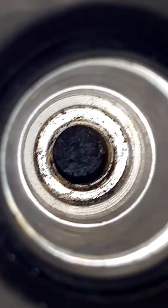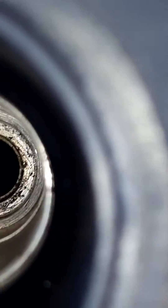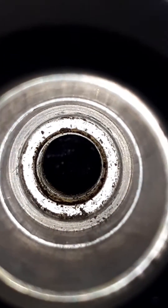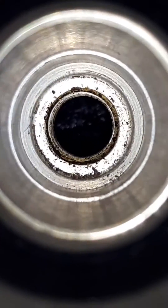But these are glares coming off of the top of the piston, and what that is telling me is that there is oil residue on the top of the piston. So this vehicle is burning oil, and that is causing the oil residue on top of the pistons.